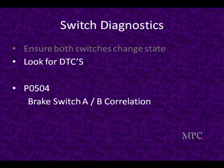Remember, the brake switches are critically important — they are the safety net for electronic throttle control. Electronic throttle control depends on the brake switch to always start decelerating any time the motorist hits the brake. Do not try to drive one of these vehicles with one foot lightly on the brake and one foot lightly on the gas, because the brake will take preference. Make sure you go look at the fault codes and fault modes because they'll tell you where to go. The biggest complaint people have about electronic throttle is strange vehicle operation, and all of this gets explained when you thoroughly go through the operation, the inputs, and the outputs for the TPS and the motor control.